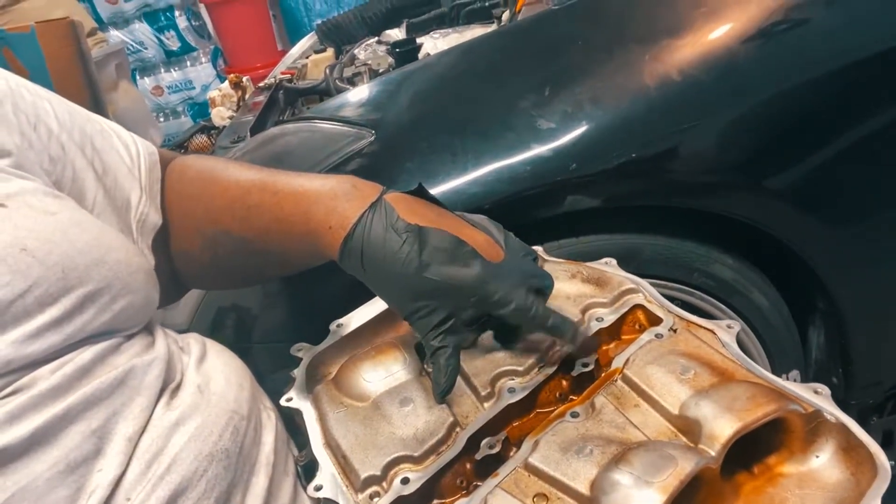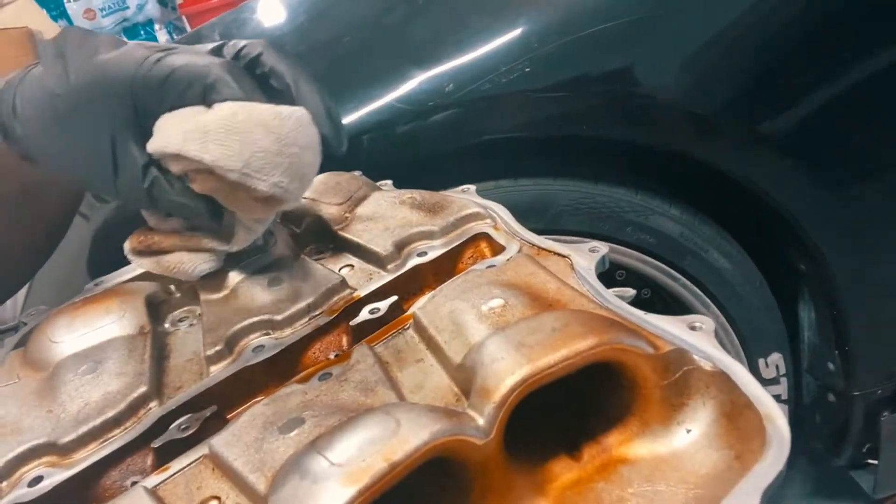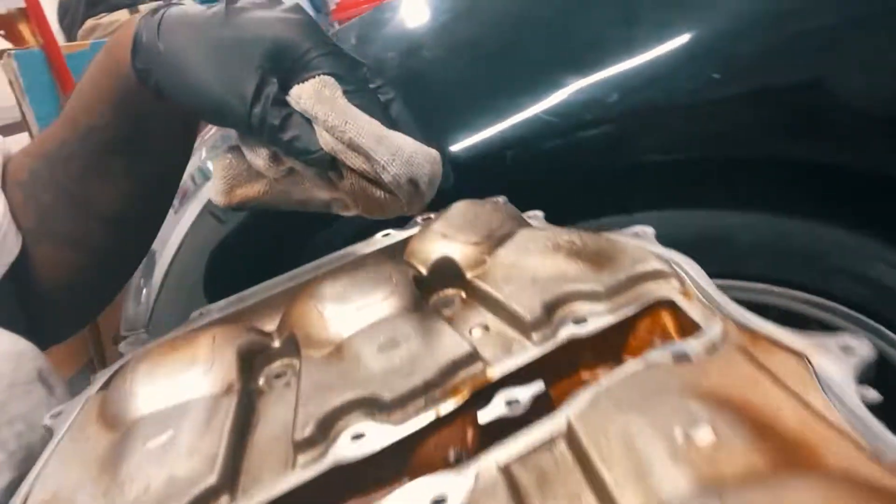So that's the upper right there and the lower here. As you can see, it's just full of oil deposits. Over time, the oil just sits in the ports and develops a nastiness. Because the plenum is receiving air constantly, any obstruction is going to cause performance issues — you guys know how that goes.